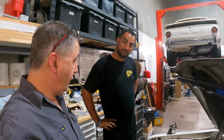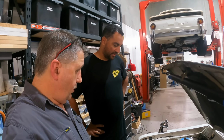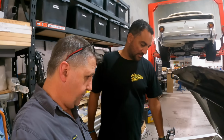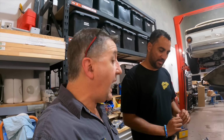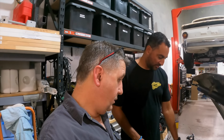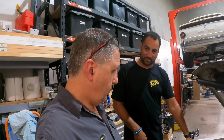Really, really exciting. So, what are the plans from here? What do I have to do apart from just twiddle my fingers? I don't think you have to do a lot because you've done it. I'm going to put a diode in between the lights. Oh, and Shannon, big help here with the hard work. Nice one. I'm going to put a diode in the light to the alternator because for whatever reason, now it stays energized. I think the old coil used to draw enough power that it used to kill the system, but now there's no load. There's absolutely no load on anything to alternator what it draws, because it's all through the battery and the ignition switch. So there's no relays, there's nothing to draw power down. So I'm going to put a diode on there, which is just a one-way.